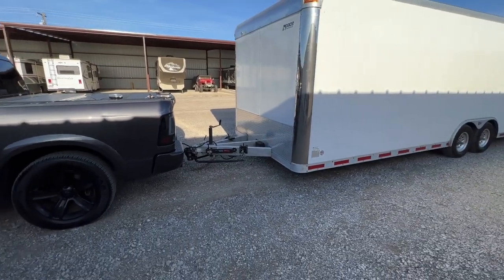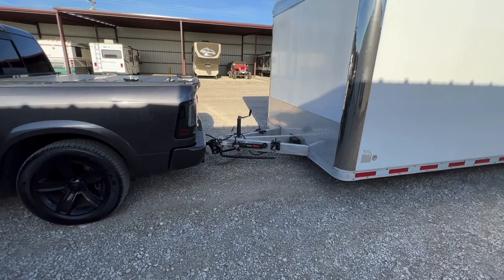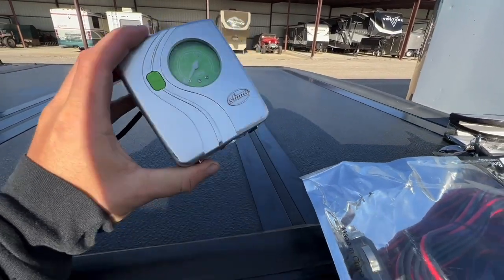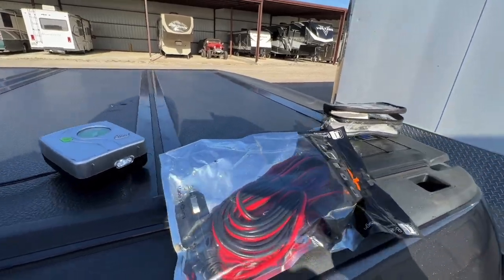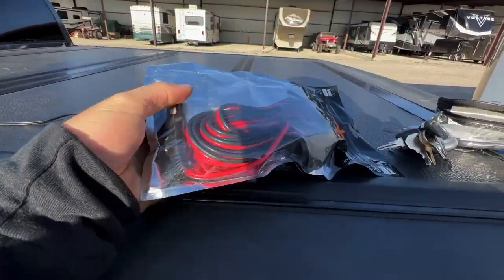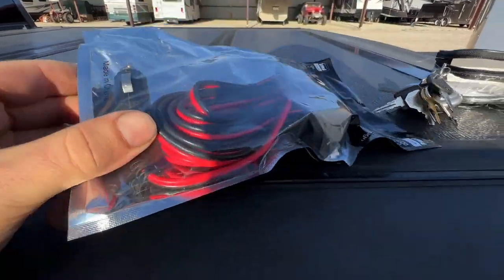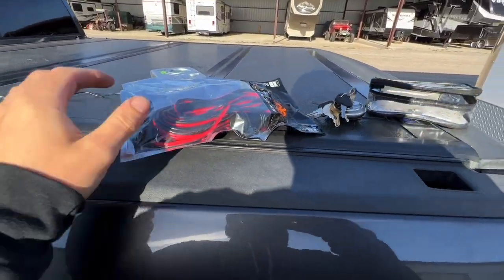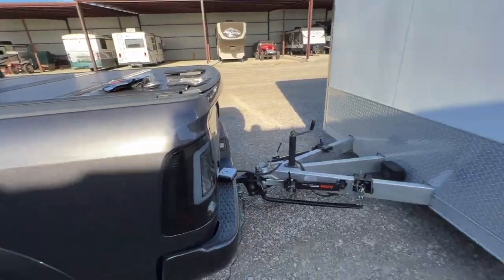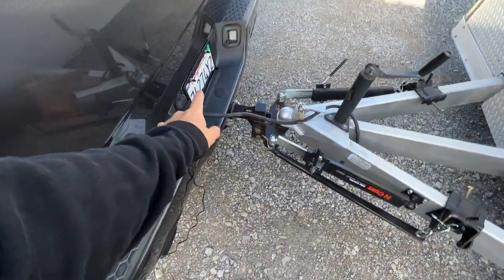Next up — pull out and get on flat ground. You can see we've got a little more squat in the back and I haven't put any air in the airbags. You can go to the gas station, but I've got a cheap little pump. You'll notice even if you plug it into the back seat you can't reach the back of the truck, so I'll link this in the description — it's just a 20-foot cigarette lighter extension. That way you can reach all the way to the back and even fill up trailer tires if you needed to on the road.